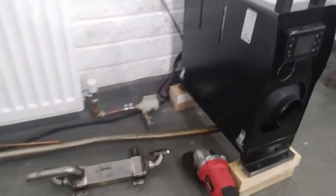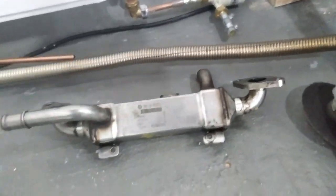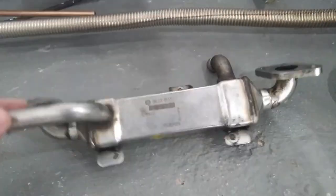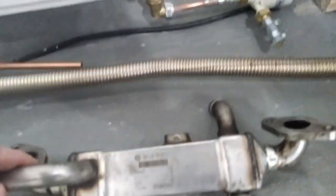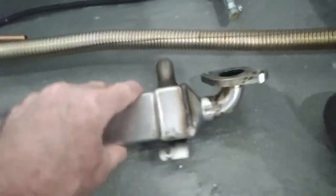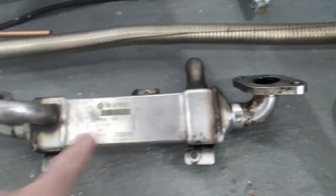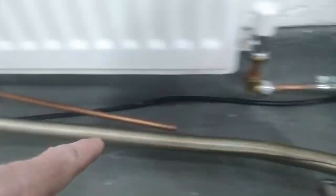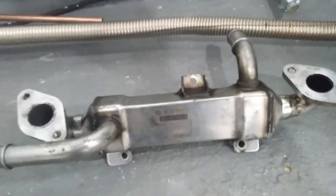We're messing with the heater again in the garage, still trying to make use of the heat from the exhaust. I just had delivered a Ford Galaxy heat exchanger, bought off eBay for £15 - it's a really well made little piece of kit. We're going to splice this into the exhaust, cut it in, so the exhaust comes in one end and out the other, with two water pipes attached to the radiator to hopefully heat the water quicker.